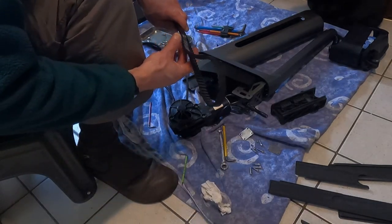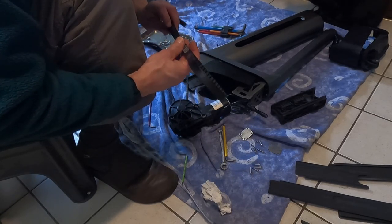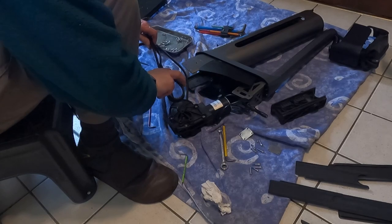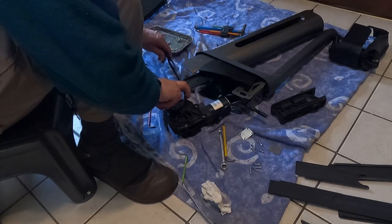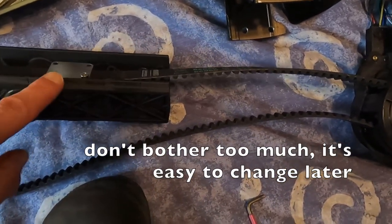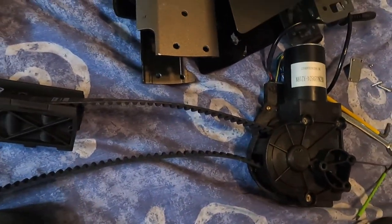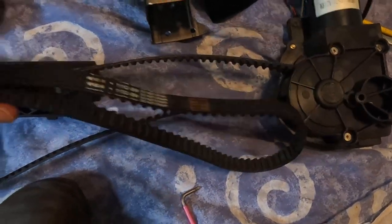But what we need to consider now is where the clamps were in relation to where that bottom pulley was, to get that back in the right place. It was about there, so they need to go about there. So I'm just putting the clamps back on for this piece. Just need to double check that I've got it in the right location along that side of the belt from the pulley. The old belt, put it on there, and then I'm going to measure and just check.